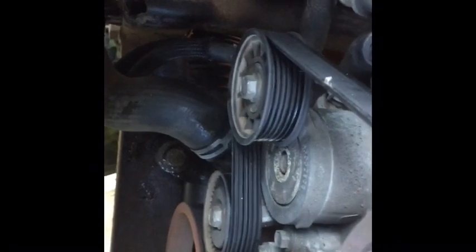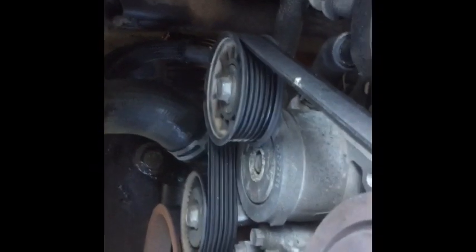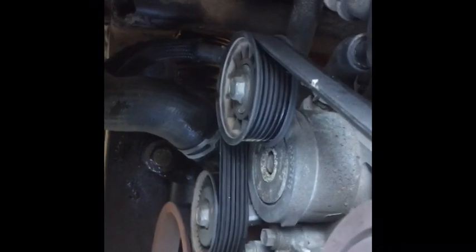One thing we've got to make sure we don't forget is to put our lower clamp back in place on the radiator. Just remember, when you're tightening those bolts, they are small. Do not tighten them too much, you'll break them. Snug plus a tiny bit, that'd be my advice if you don't have a torque wrench. If you have a torque wrench, look up the specs.